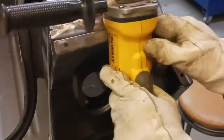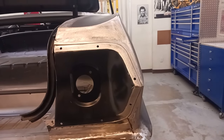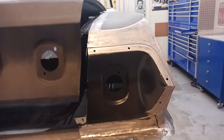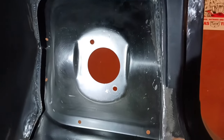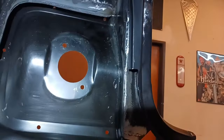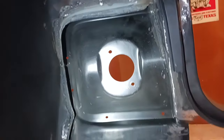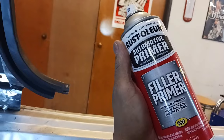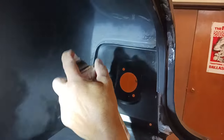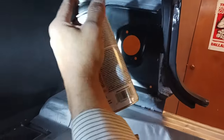That'll be for nothing if we made the metal thin and it cracked out later — that's not what we're doing here. There it is. We've still got a lot of work to go — we've got to work on that trunk gutter side. I'm never afraid to show the inside or back side of the panel where I welded — we've come in and touched it up, dressed it down just slightly. But remember, this is all going to have spatter paint and seam sealer in it, so that's not going to be an issue. We've got it prepped and we're going to shoot just a little bit of primer in there so we don't get any rust started — we are in Texas. I can live with that. Get ready, we are trying to get this thing knocked out — thanks for watching.